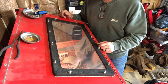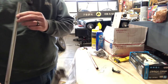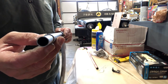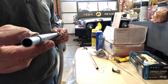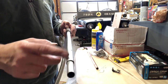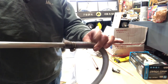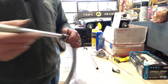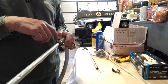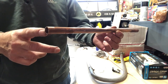The new gun is installed - you can probably see that through the nice clear window. We're going to give that a shot, but not until after we make a modification to the pickup tube. The original tube that came with this - you can see it's double-layered. Some genius thought you'd be able to suck enough air up between these two pipes, and you can see where it's dimpled to try to create that space. But where is it going to draw its air from? There's no way for air to get into the system from this location.